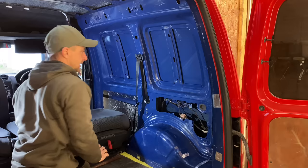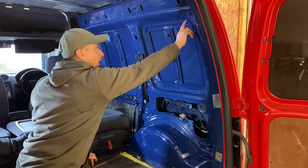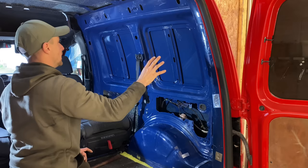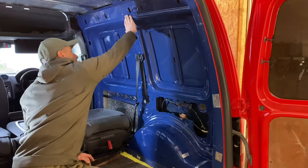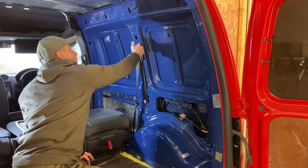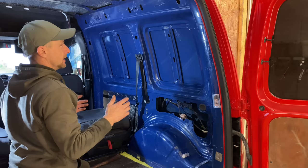The full paneling — which was what this van had — is not the route we're going down. I want it to be a bit spacious, but I also don't want to just carpet it. The third option is to cut board in as small as possible, giving a nice flat surface with insulation and vapor barrier behind it. I'm going to come 60 mil in from the second pillar rather than going all the way out to the roof — so we lose 55–60 mil of space but it looks a lot bigger than full paneling.